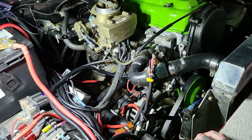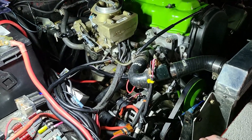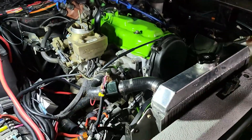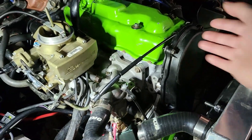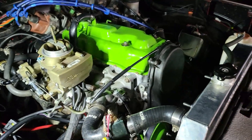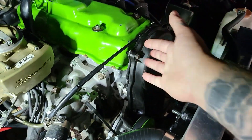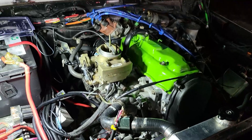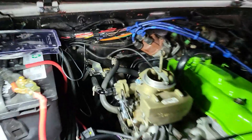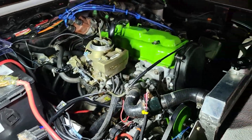It had a 5-amp drain on the battery — it killed the battery overnight. The alternator was energized all the time before; that's supposed to come on with the key. I had to put a cam seal in it — it was literally smaller than the hole in the head. You could see daylight around the seal. It was just pouring oil straight onto the timing belt. I put a timing belt on it — it's got a new timing belt and everything. Matt put on a new heater valve, new hoses, and remounted the fan.